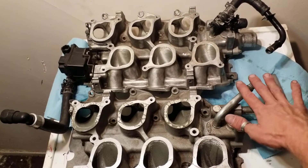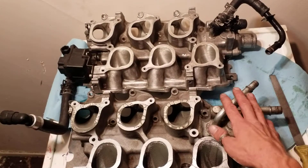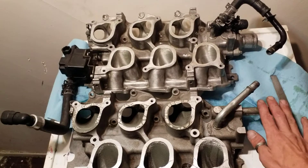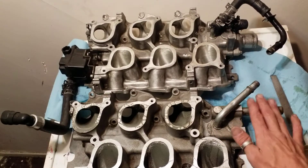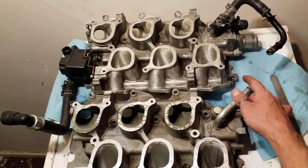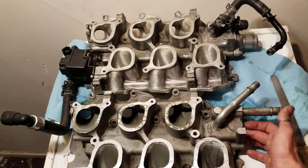When it's hot and the actual thermostat has to open up, this line is going to get a good amount of extra pressurized flow. So when it comes down to crossing out between a non-pressurized line and a pressurized line, you're going to have to get rid of the non-pressurized line. Because if you try to block off the pressurized one, it's just not going to be happy when you open the thermostat — it's putting a direct shot into that.